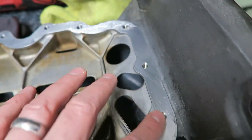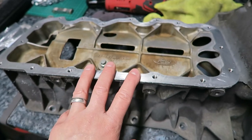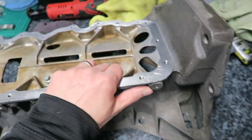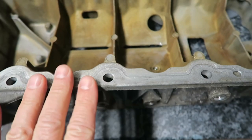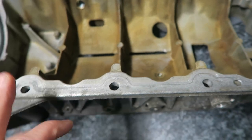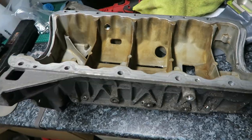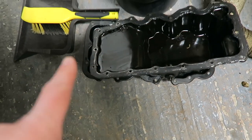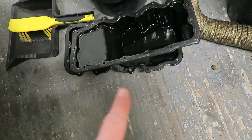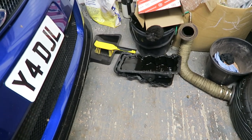Probably not completely level but it's all good. Picked up some brand new bolts as well - these all fit in perfectly. We're going to get the lower sump back on first, got the new gasket to seat. I'm going to put this on the car first - there's a sequence pattern to do. I need to get my Haynes manual which I've actually bought for Christmas. Then we're going to go to the new sump - I think that's the old one, that's the new one. Get that put on, get everything back on the car, get it filled up with oil and hopefully it starts.